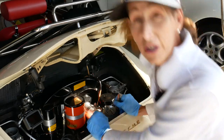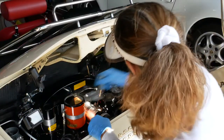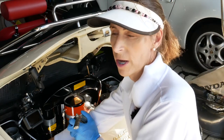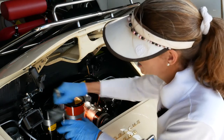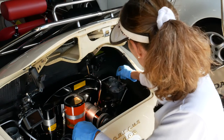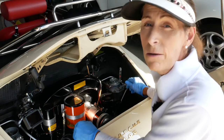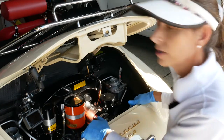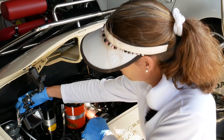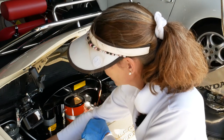That sounds a little more normal — believe it or not, that's 1000 RPM. Let's see how close we are on the flows. The right one's a little low but we're still a little high on our idle, so we'll lower the left one just a smidge. It's about halfway on both sides. Idle-wise we're right around 900.